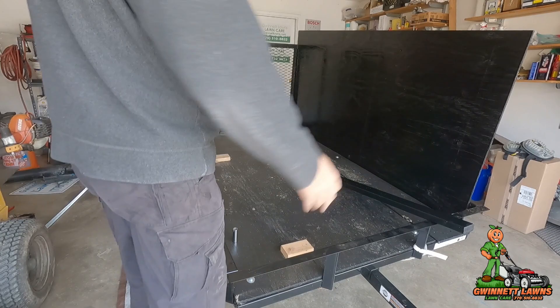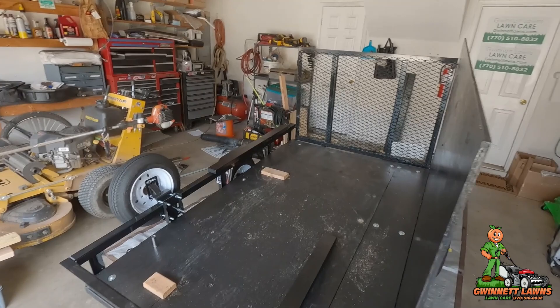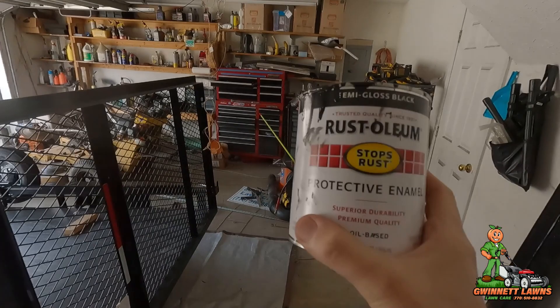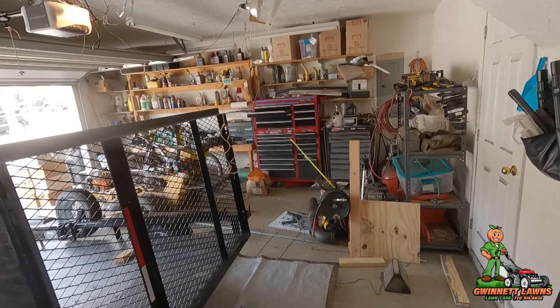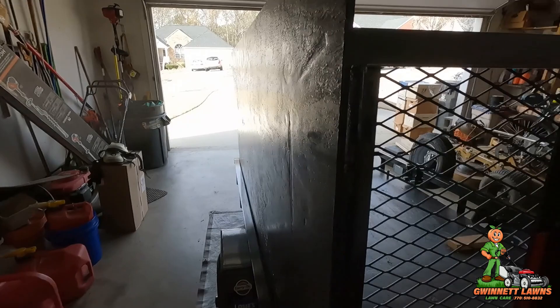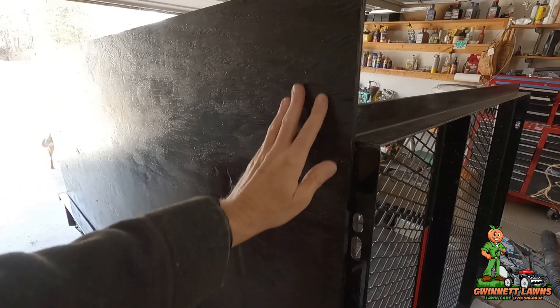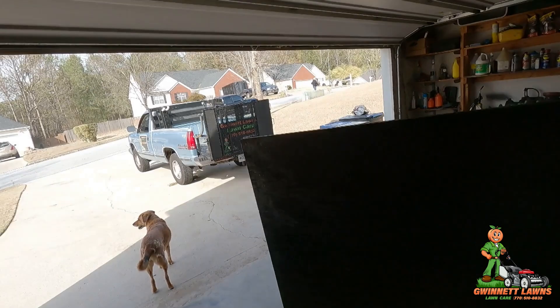The goal is to make it useful not just for lawn equipment but for hauling just about anything. I already painted both sides — I use a good primer on all the surfaces and then Rust-Oleum oil-based protective enamel, which is phenomenal. I'm using non-pressure-treated wood because I want lightness. Same thing I used on the headache rack — if you seal it properly, it will never rot.